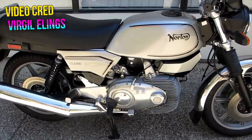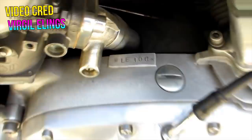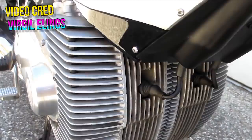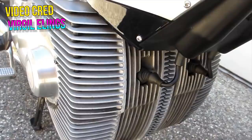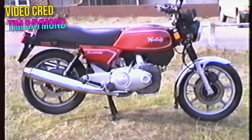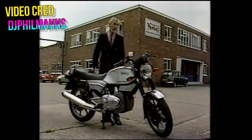The 1987 Norton Classic was a complete paradigm shift in comparison to how Suzuki handled the problem of rotary heat over a decade before. Suzuki went with very complicated measures to deal with the heat and fueling, while Norton kept things extremely simple. Engineer David Garside argued that with 588cc of displacement and two rotors splitting the load, the Classic would only need air cooling so long as it didn't exceed 80 horsepower. The inside of the rotors were cooled using a ram air system, and the header pipes were simply tucked under the engine. Unlike Suzuki's complex car carburetors and three separate oil systems, the Norton used just one oil system.